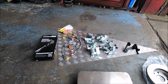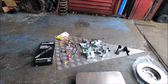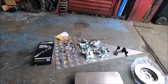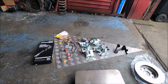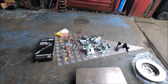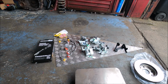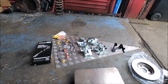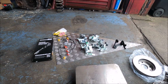This is standard front and rear brakes. Not only standard front and rear brakes, but the 1.6 Mark 1 ones, which are the smallest ones you can get. The reason is they're fine, and more importantly, they're the lightest. Unsprung weight makes a big difference to performance, more than normal weight. Unsprung rotating weight, as in brake discs and wheels and tyres, of course, makes an even bigger difference.